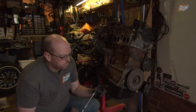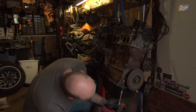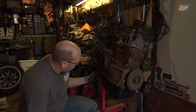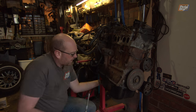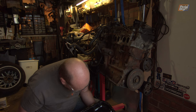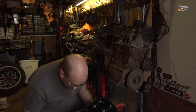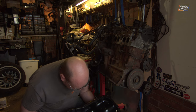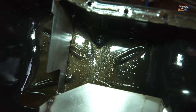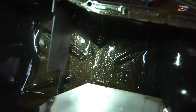Now it's on the engine stand, we can get the last few bolts out of the sump and have a look inside. We have had this sump off before and the results were not pretty — the oil and everything was terrible. And yep, it hasn't gone away. There is still a really upsetting amount of bearing material in the bottom, and there's still a little bit of residual oil that didn't drain out, along with a lot of metal from when we were at Ignition Motorsports on the way to the MOT.